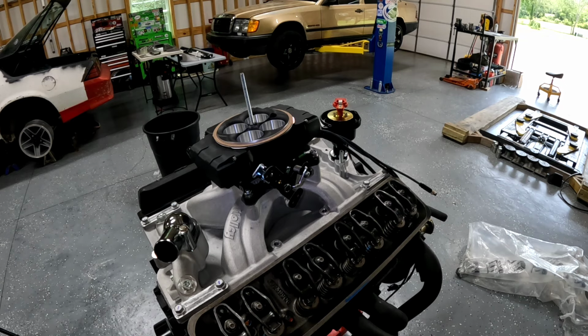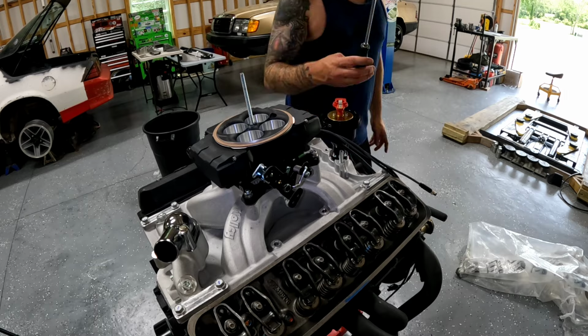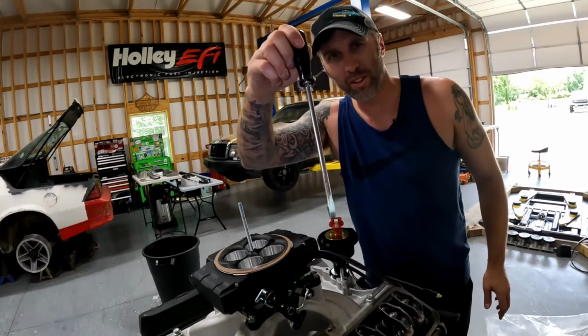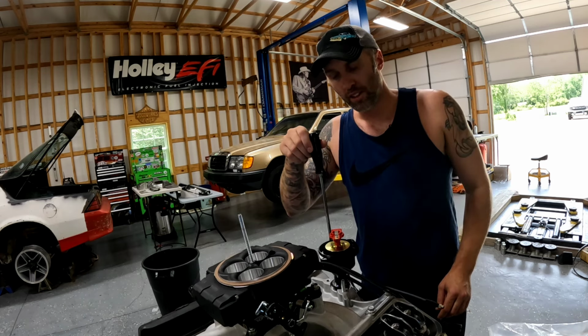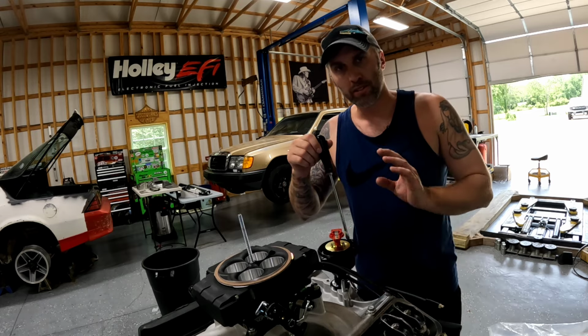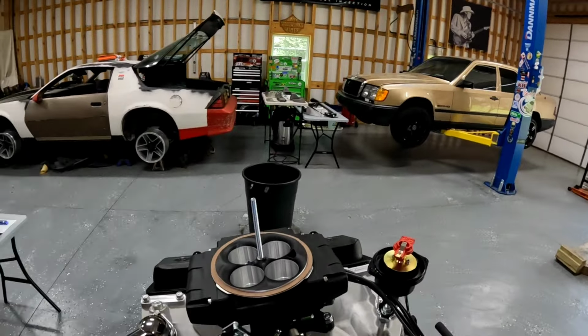All right, we got our distributor facing our number one cylinder now, or pretty close. Might mess with it a little bit more, but when you're having trouble with these distributors, get yourself a really long flathead screwdriver, pull the distributor out and stick it down there until you hit that oil pump drive shaft and move it around till you get the distributor to line up where you want it. It can be a little tricky. Just take your time. We're gonna move on to phasing the distributor,